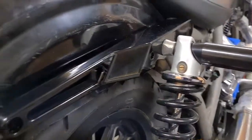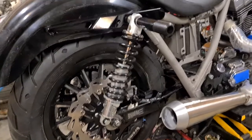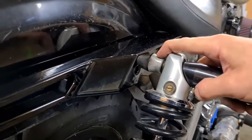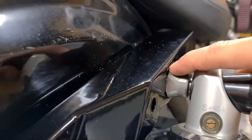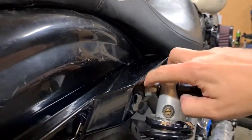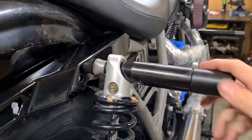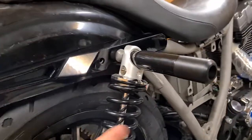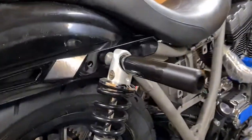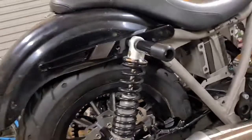We've got the FXR Division RP-style struts to keep the shock mount in the right position. I've got late-model Dyna shock struts that I had to machine a little bit off because they wouldn't reach all the way into the inside of the fender. That later-model shock mount lets me run my mate's rear shock mount protection bars — these are crazy nice as well, all CNC, half-inch drive on one end with removable Delrin sliders.